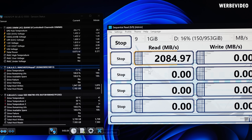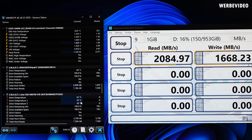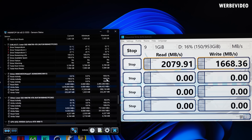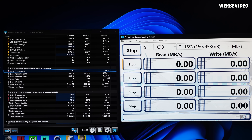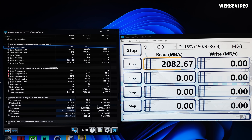On the second run — about two and a half minutes of load without a heatsink — we're now at 70°C. You can check in HWiNFO while running the test if it's throttling or exceeding a thermal limit. This is still fine and in line with what the SSD is supposed to do. I saw a peak of 79°C which is still okay and within the limit — read and write rates are as expected, so it didn't throttle yet. I briefly saw 82°C with a slight dip in write for maybe a second, then back to normal. Over 10 minutes of full load and it still hasn't started throttling.